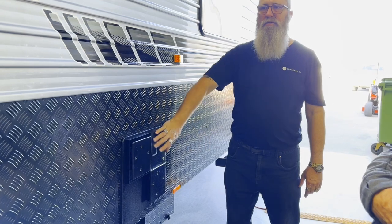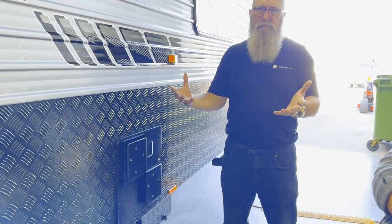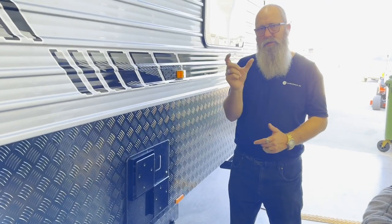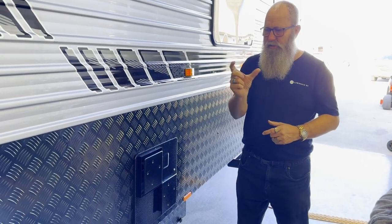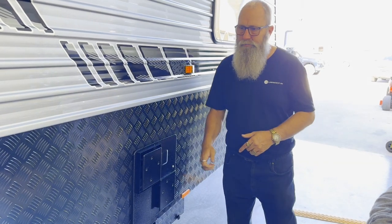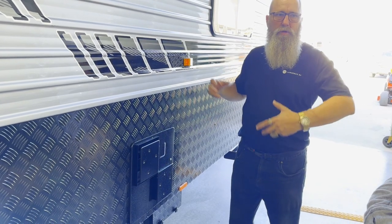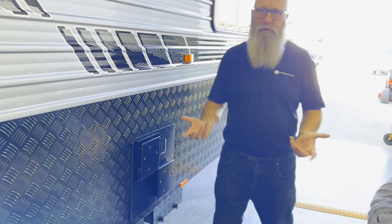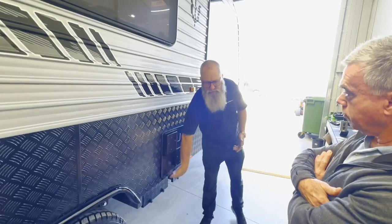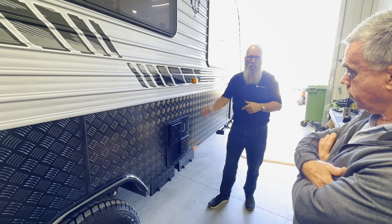Now, these ones are a sealed unit, so there's nothing you need to do to them. They're a stainless steel tank, 28 litres, but it still has the sacrificial anode in it. It's a little tiny piece of aluminium rod, so it needs that to protect your tank. When they get hot, they also expand, which means they will relieve that through the valve on the bottom end, where there's a hose. So normal operation is dripping. You'll get hot water dripping out of there.